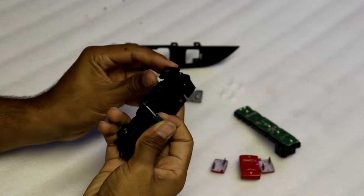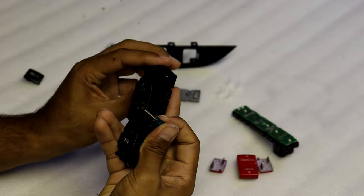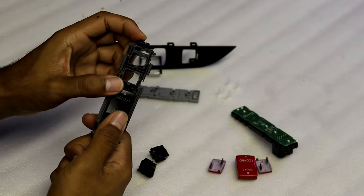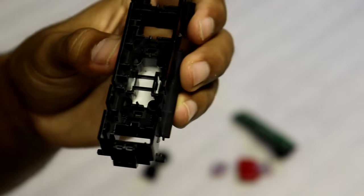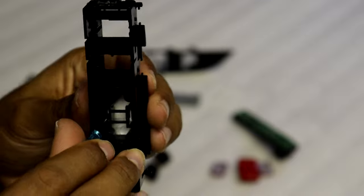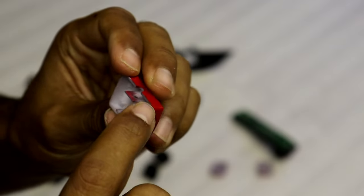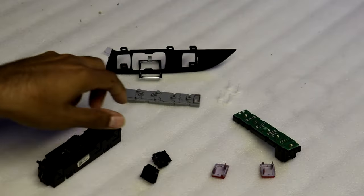I got this one off. The piece inside is going to fall out once the button is unhooked from it, so just be aware of that. The drive mode selector button is a little bit different, but essentially you still need to use the flathead. You can see on the new one there are holes on each side and a black piece that hooks inside those holes — you basically just put the flathead right there and push outward so it unhooks from those two black pieces.